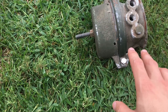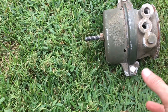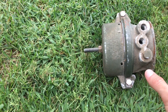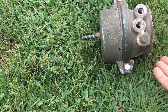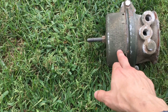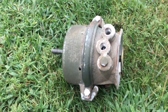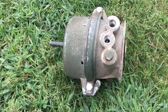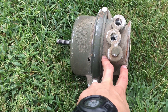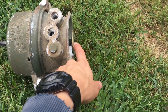We're going to do the entire chamber replacement on those. This is the safer and more beneficial way to do it because these trucks are very old — my truck is anywhere from 1984 to 1986, rebuilt in 2010, but they didn't do everything. If you get parts that are severely corroded or worn out, just replace them, because the safety risk with this spring in here is just not worth it. Don't take it apart and put yourself at that kind of risk. Some shops will try to sell you on rebuilding this section and reusing the other side, but if you're messing with the springs — absolutely not, don't even bother.